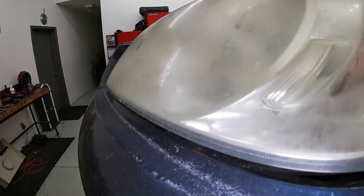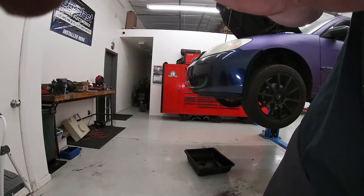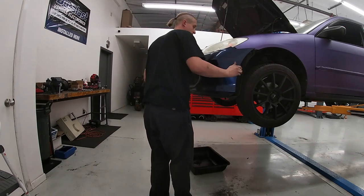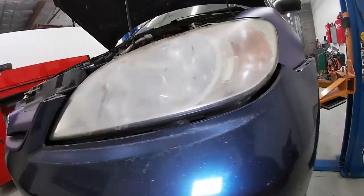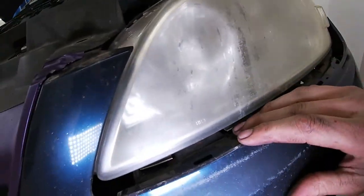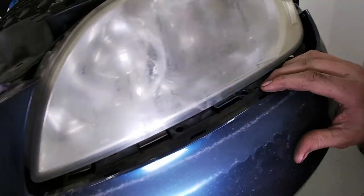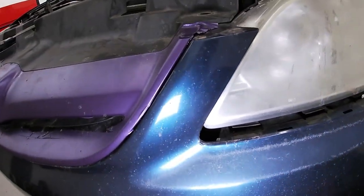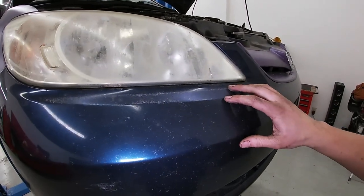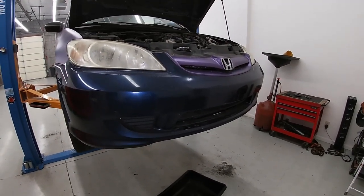There should also be a few clips around the headlight area as well. Be as careful as you can and try not to rip the bumper cover. Get your arm in behind the bumper to push on it to keep even pressure. These ones up here are a metal bracket but they still pop into those same style holes to retain it. Once this whole side of the bumper is loosened up, do the same with the other side — but be careful because once you do that the whole bumper cover is going to try to fall off, so make sure you have it supported so it doesn't get damaged or scratched.